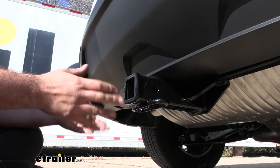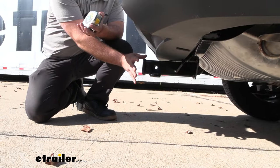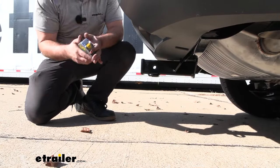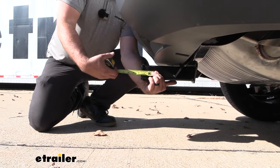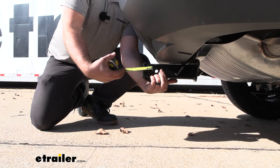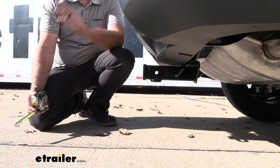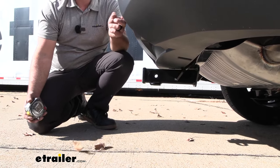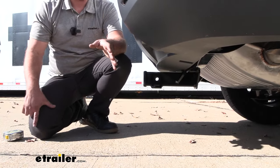This is a really great hitch — it's going to open up the window as to what you can do with it. It does sit pretty far recessed on the fascia, which is great for a clean look, but some of your folding accessories go into a vertical position and from the center of the hitch pin hole to the furthest point it's going to be five inches. So something to keep in mind when choosing those accessories — making sure that they stick out far enough to not make contact with your fascia, or that they can actually stow in that position at all.